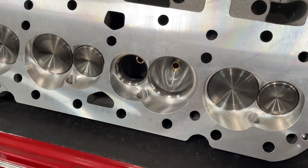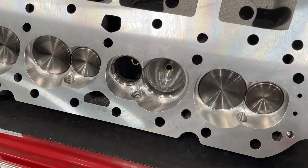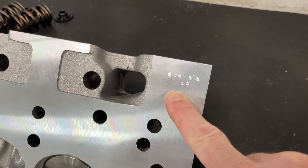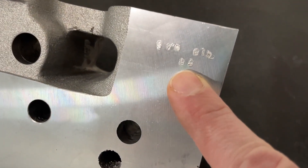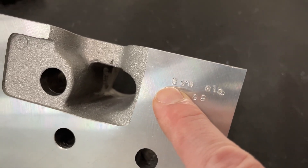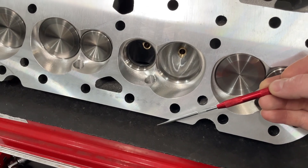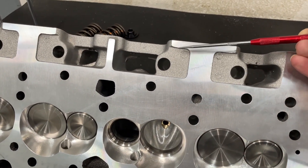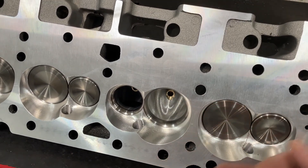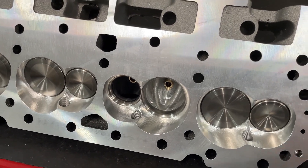In this case, what AFR did — because they're not going to take that much off flat — is a combination angle mill and flat mill. AFR does this, and if you ever see the marking on the head, it means they milled it. It's upside down and it's 58cc. This tells you what they did — an 18 and a 45. My guess is they did 45 thousandths angle mill first, and then dropped another 18 flat to get to 58cc. So first angle milled, then flat milled.